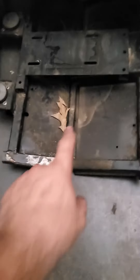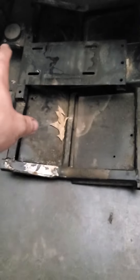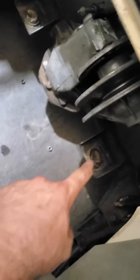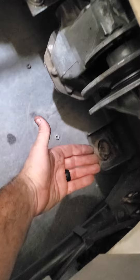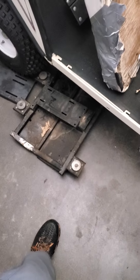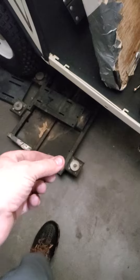This plate here is the engine mount, and this is the original engine mount plate to the golf cart, which sits on top of here on these mounts. What I'm going to do is mount it on the bottom side, underneath these mounts, so that will lower it maybe half an inch or more depending on what kind of bushings I use. Maybe I'll get inch bushings and get some more clearance as far as the top of the engine is concerned.